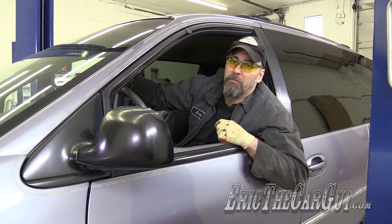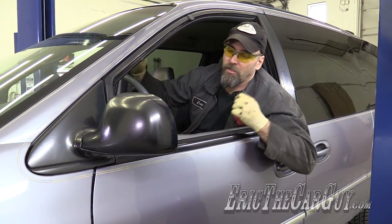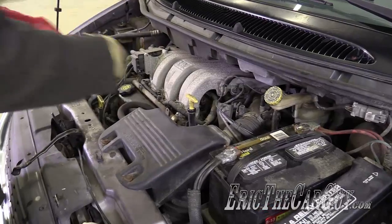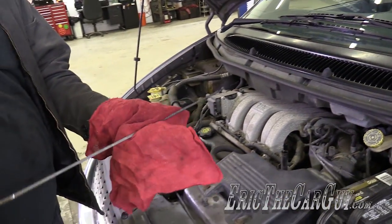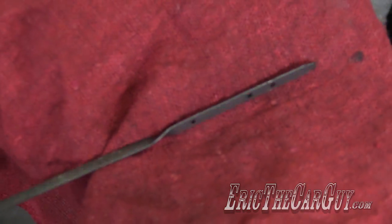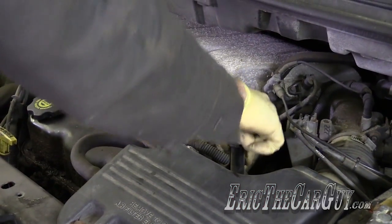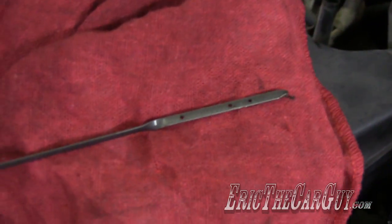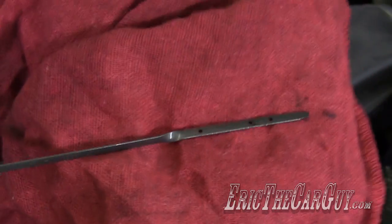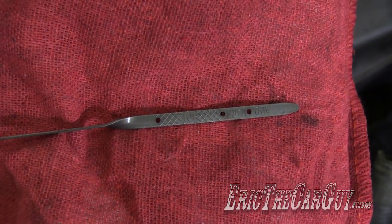Well anyway it's heated up, I'm going to put it on the ground and just check the fluid level. We obviously know that we don't have reverse, and that's pretty important. So let's check the fluid level and see where we're at. The engine needs to be running and it needs to be on a level surface. That's not looking too good. Nothing — it's not even registering on the stick. An automatic transmission without the proper fluid level is an inoperative automatic transmission. It needs that hydraulic fluid to work.